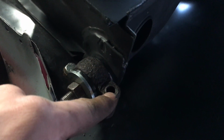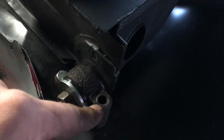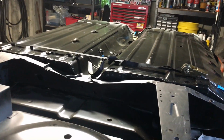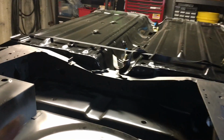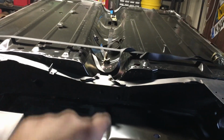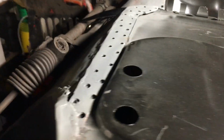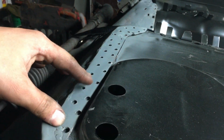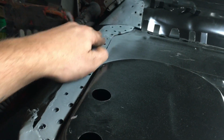That's not far off. I think it needs a bit of wiggling, maybe adjusting this maybe. And it's the same story here with that. So effectively, everything's had to go that way. You can see I've used straps to ratchet it forward, and I'm quite happy with it now. I'm going to take measurements. I'm not touching a welder yet. But it fits along here nice. I've put this piece in here, so you'd see the weld mark there and stuff like that.